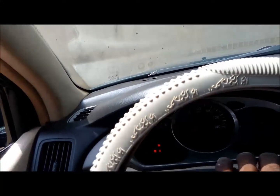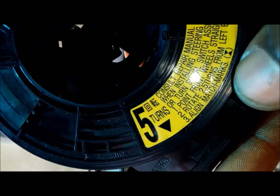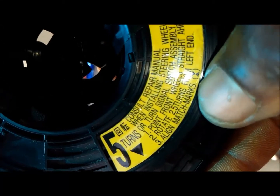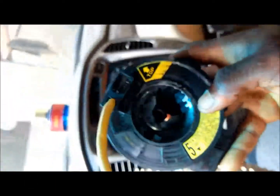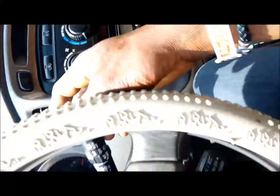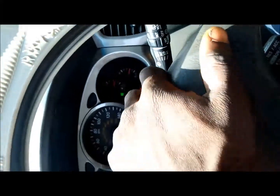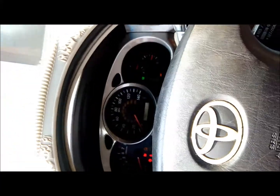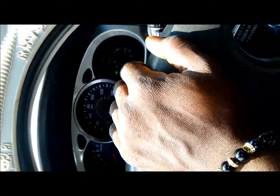Testing it directly from the relay, as I showed you guys earlier, it worked properly. So I've got my airbag ribbon — as you can see indicated here, it says five turns. If it goes beyond five turns you could snap the airbag ribbon. The one on this car is possibly bad because the horn is connected to this ribbon, and all these other controls are connected with the ribbon. I've been noticing it sometimes — there's a while upon my steering the horn would work, and there's a while upon the steering it wouldn't work. So I've been suspecting my ribbon was going bad.